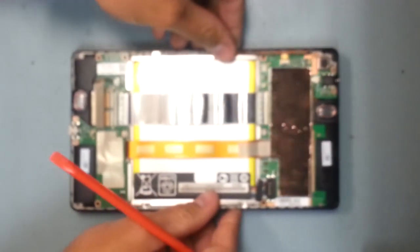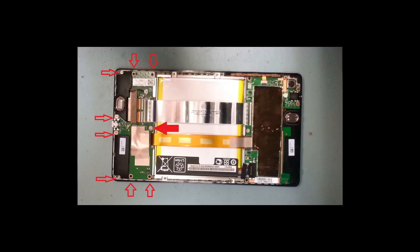We're going to start at the bottom end of the tablet — the charging port. Here's the screw layout. The dark arrow is pointing towards where the void sticker is, so you can just peel that off. Obviously Google doesn't want you working on their tablets by yourself, but sometimes you've got to. Take all the screws out and keep them organized — that's the best advice I can give.